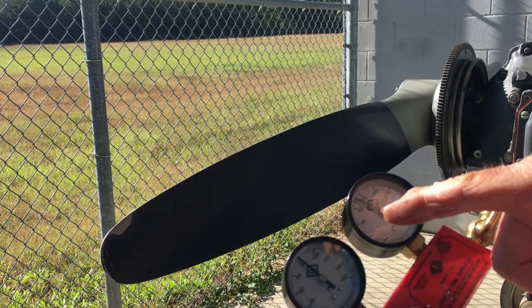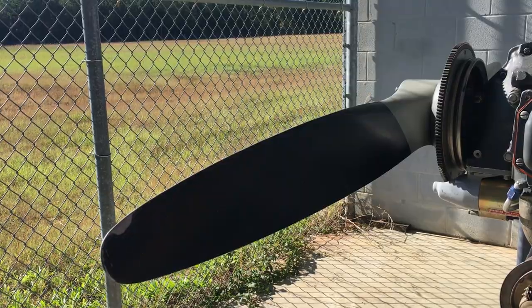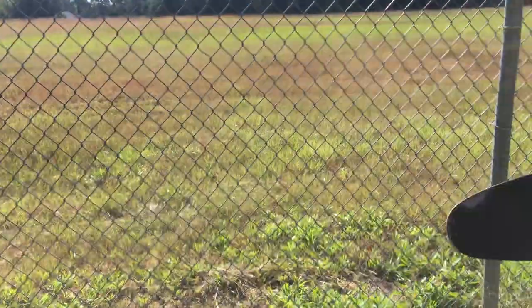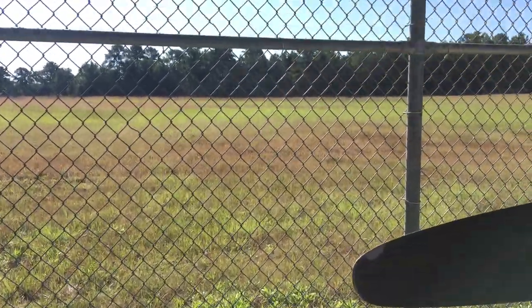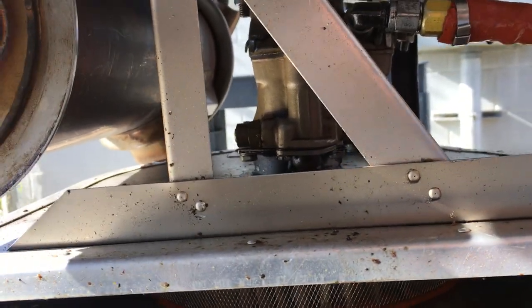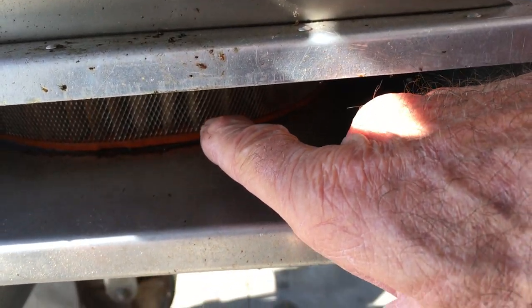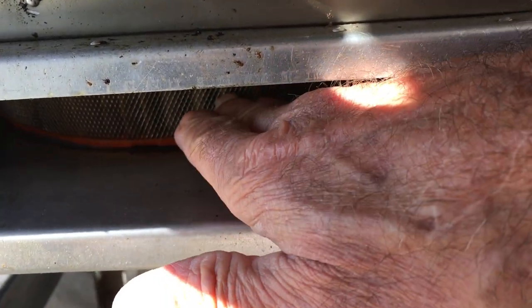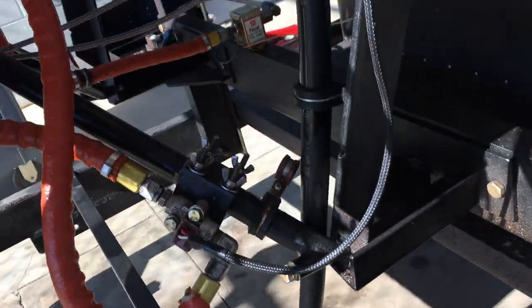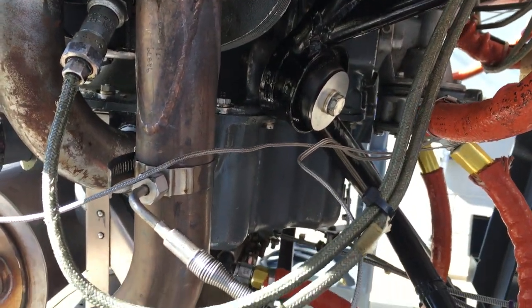One of the things you can do is listen at the air inlet. Stay out of the prop arc because we've got pressure on there. This is the air inlet to the engine. If you have an intake valve leak, you'll be able to hear hissing from here. There's a leak because we don't have 80 over 80 — a cylinder will never be perfect. So where is the leak coming from? If it's coming from here, that's an intake valve.